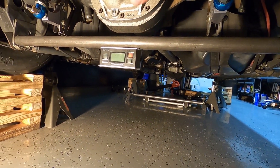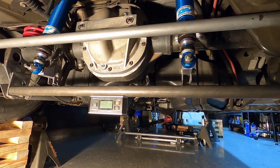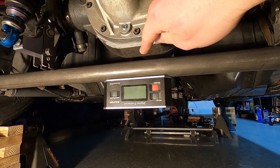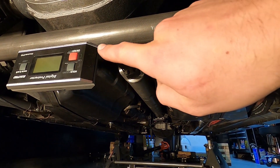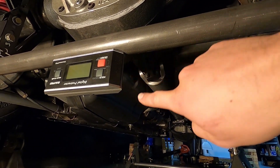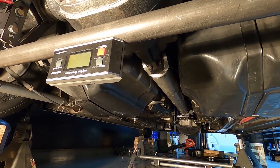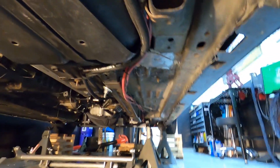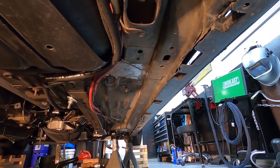It's about exactly level with the rear end. What my plan is: on the forward side of this tube is going to be the mount for the wishbone. The wishbone is going to mount right here, right underneath this level, and it's going to go forward with one leg that way and forward with one leg this way, up to the front of the fuel tank right here. There's also going to be a crossbar that goes from right here — you can see that spot I cleaned off — that's directly the bottom of the cage, and there's a six-inch plate right there.